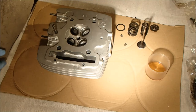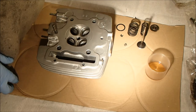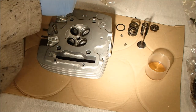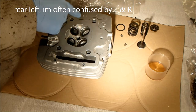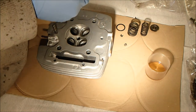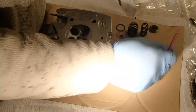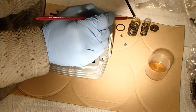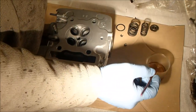I think I'm organised now - clean valve parts which are going to get re-oiled and put back in. I have the bag that each set came out of; every time I take anything apart I put it in a labelled bag. This one is labelled as the rear of the cylinder on the right-hand side, so we know which valve it is and that it's been lapped into that particular seat. Now just lube up the valve stem with engine oil - probably way too much, but better too much than too little.